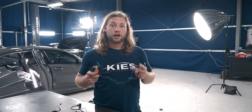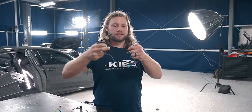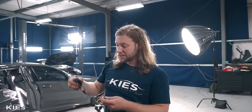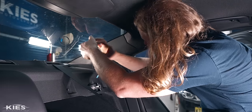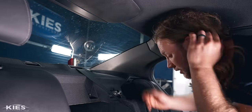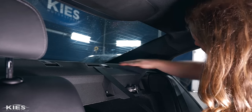Even BMW makes their wire a little longer than needed and just tapes it up — I'm going to do the same thing but with Tesa tape. The Beamer Tech tweeter has a super long cord compared to the tight BMW one, so I'll wrap up the cord with Tesa tape so it's approximately the same length. Then just reinstall — it's been difficult filming through the tinted rear glass but it's the same process we've been doing all along. The tip of the triangle goes towards you, get everything tightened down, then gently snap the cover back into place.